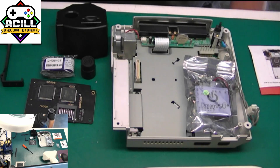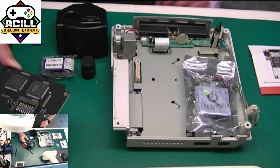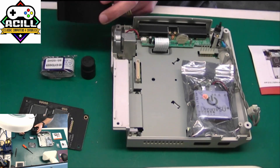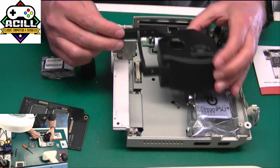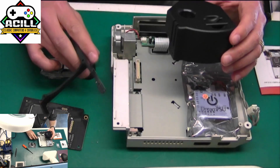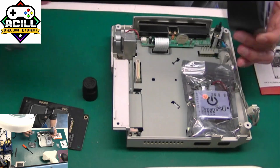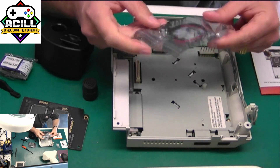Welcome back to another edition of this Dreamcast update. I finally got the parts in — it's only been a couple of days. We have the GDEMU that I was talking about, which is going to take the place of the GD-ROM drive. It's a really nice resin 3D-printed bracket that will mount the GDEMU and make it look cleaner, with a little reset button and an SD card extender. We've also got a cool DreamPSU to replace that old big power supply unit with a more modern one.